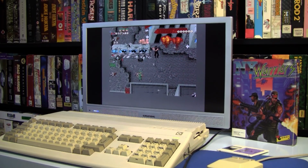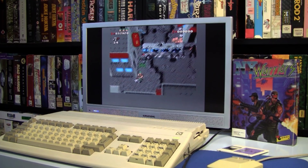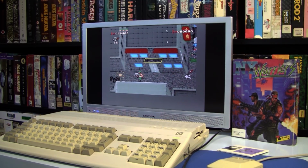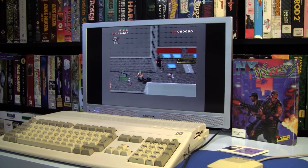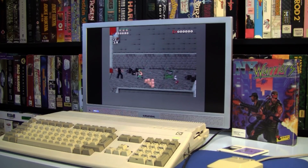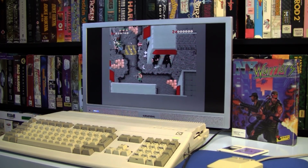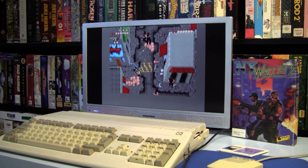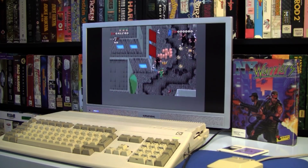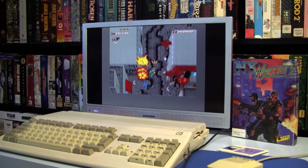Now I'm not that familiar with programs since I've never used that many back in my Amiga days, but when it comes to games I know that there are some which can handle any type and amount of RAM that you can fit in an Amiga 500, then others can only handle chip and slow RAM, and others, mostly early Amiga titles, can handle only 512 kilobytes chip RAM. If you have anything more, then those games will not work, so please keep that in mind.